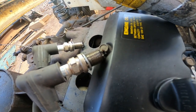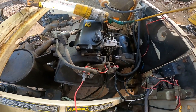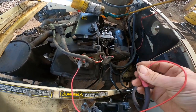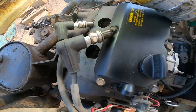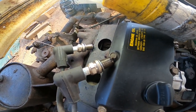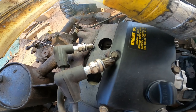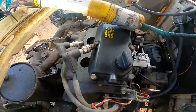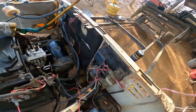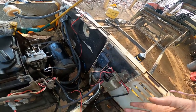See it sparks one time, or twice that time, and now it doesn't do it anymore. So I'm going to spin the engine over with this hooked up like I was doing — before it was sparking — and now it only sparks maybe on the first one. See that? It does every time I touch it on the first go and then it stops. I think the CDI — or whatever you want to call that — is going bad and it's now bad.